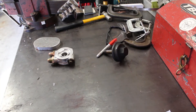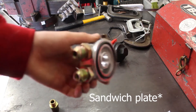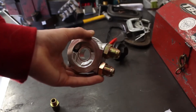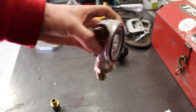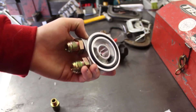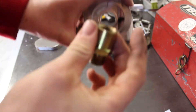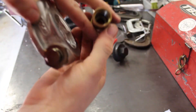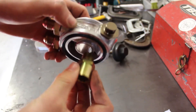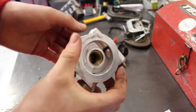Alright, so here's what came in the oil cooler kit. You got the oil cooler right here. So yeah, this is the oil cooler, it's got AN10 lines with AN10 fittings. And it has this little guy — this is made so basically your oil filter would screw into there, and that would screw into where the oil filter used to screw into, and it fits in like this.